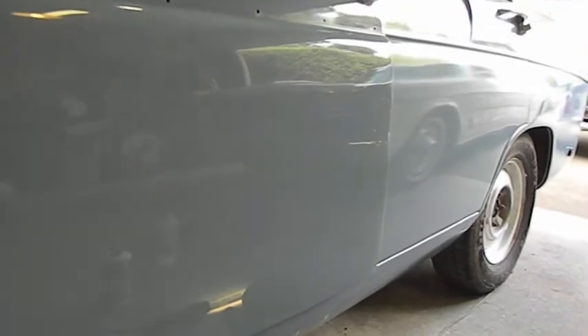There's an art to buffing in itself — just running over the thing with the buffer won't yield a fantastic result. One of the ways I always look at what I've done is by running a fluorescent light over it — it'll show up any dull spots in the work so you can see where to go over it again. It becomes sort of painfully obvious. You can see the difference there between the door that we've colour sanded and buffed, and the back door that we haven't begun yet.